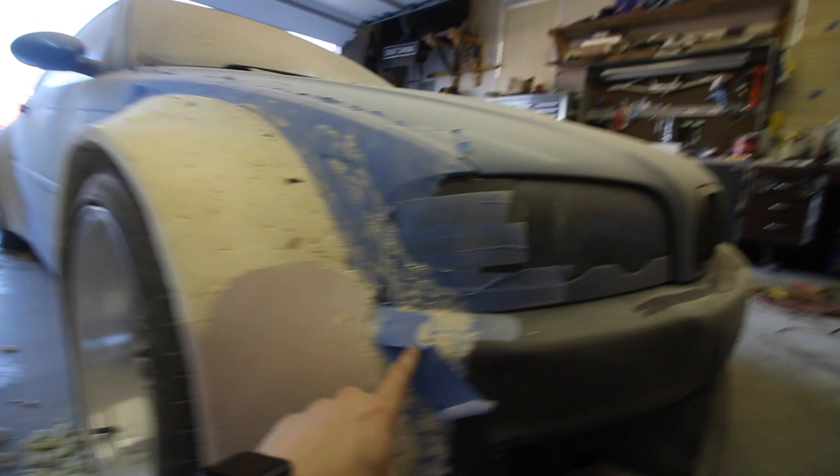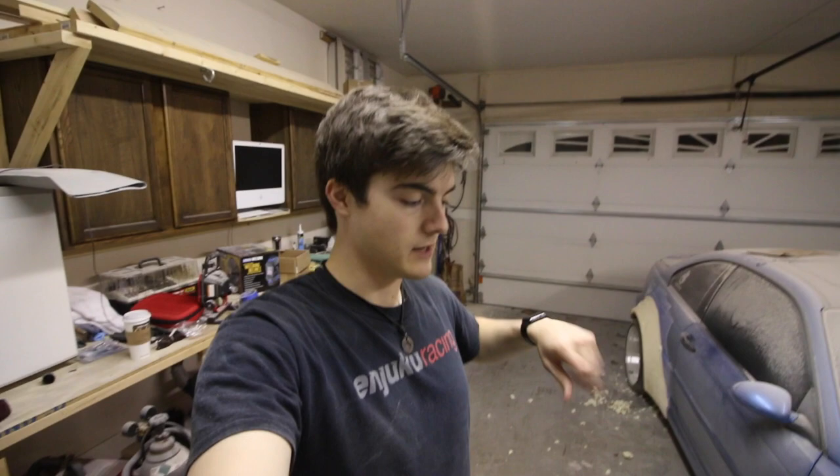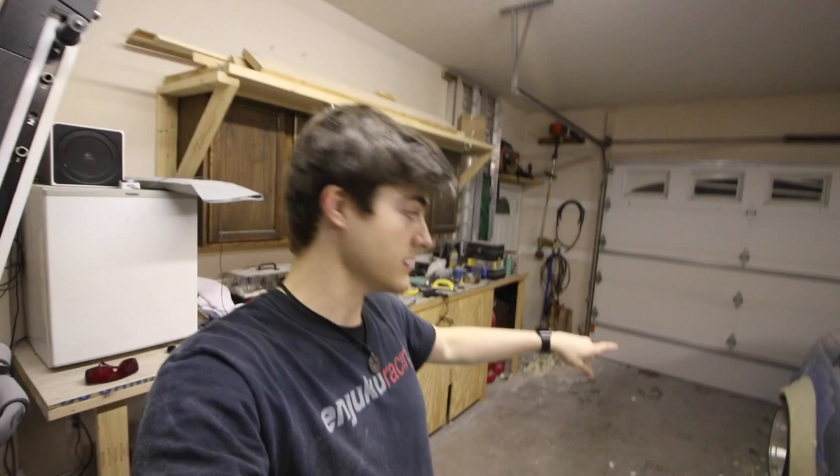The way I'm going to cut the body line into the flares — I've got my body line from the bumper and it's got to go all the way across here. If you look, I can see where the bumper connects to the fender, but that would be extremely hard to do just by eye. So I've got a laser level — I was doing some testing in the back. I'm going to flatten it out and put it on a level up there so it's perfectly straight across. I haven't marked the lines for the rear yet because I went to the store and got some more foam.